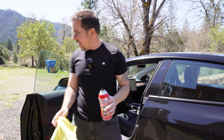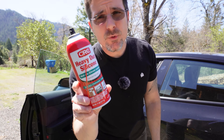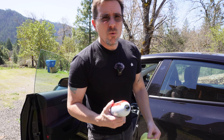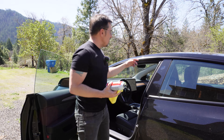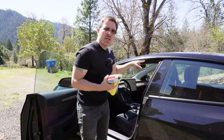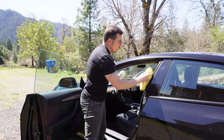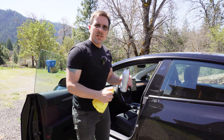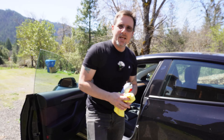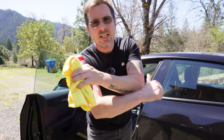Once that happens, you're going to have no wind noise left. That is the quick $10 fix. I'm not claiming it's going to work for every single person, but it worked for me, and I think it's going to work for a lot of you because it's such a simple problem — it just seems like it's not sealing on a small little section. So go around, put that heavy-duty silicone around the whole thing, test it out, go for a drive up and down on the windows, and I'm pretty sure it's going to fix your problem. Until next time, make sure you comment down below, like the video, and subscribe. I'll see you next time — I'm out!